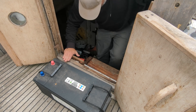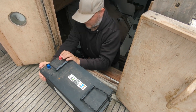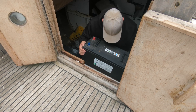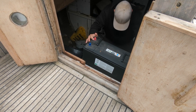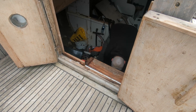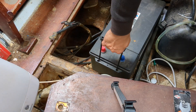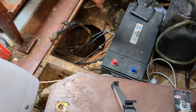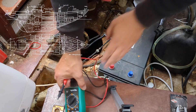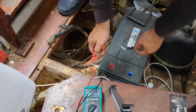Now I know there's nothing wrong with the engine itself — as I said, it ran just fine when I actually managed to get it turned and started — so we have either a mechanical or an electrical issue in the attached systems: the starter and the generator or alternator. I strongly suspect that there's an electrical issue somewhere. This might be as simple as a bad battery; the one I've been using is probably fairly old by now, so I'm going to put in a larger and newer battery that I have on hand and see if that one can manage to start the engine. However, I've also measured a drop in the voltage across the battery just by connecting the battery to the engine, something which should only happen when something is drawing power.